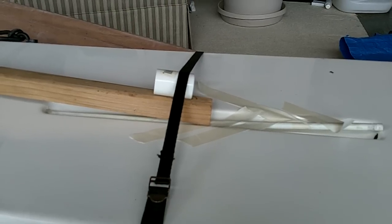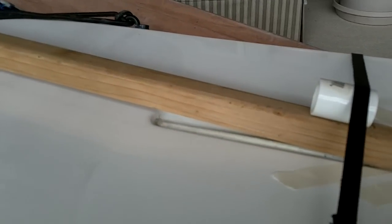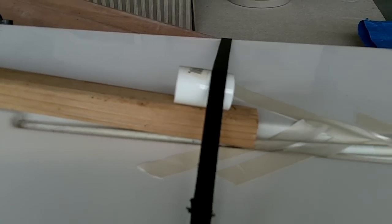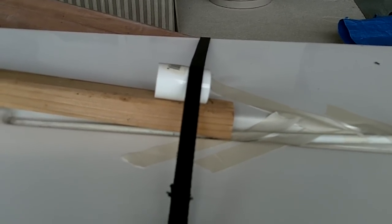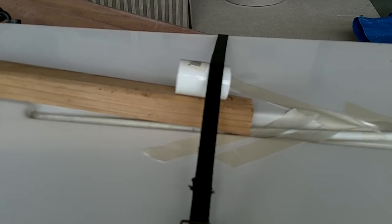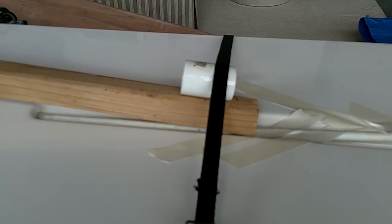After inserting the rod, I removed the tape from around the area where I inserted it, removed the excess epoxy with a Q-tip, and then jerry-rigged a system whereby I would press down on the rod while the epoxy was curing so that the rod would be sitting in its working position.